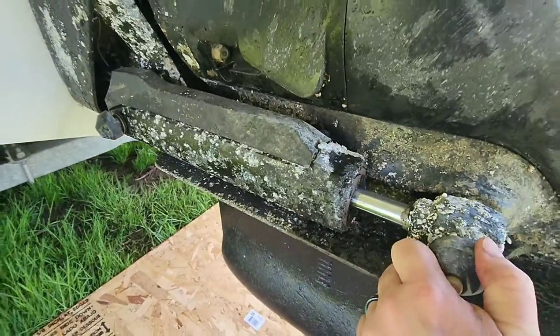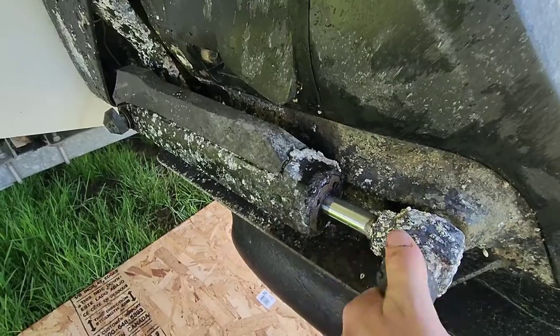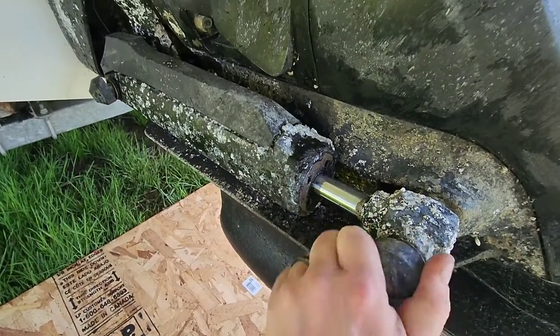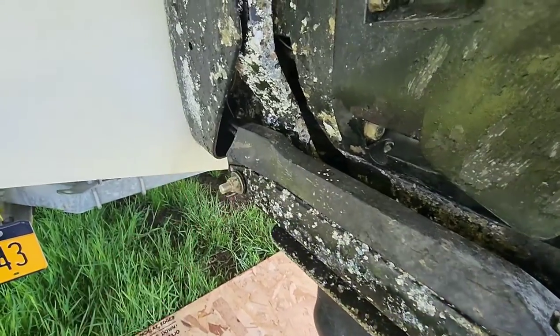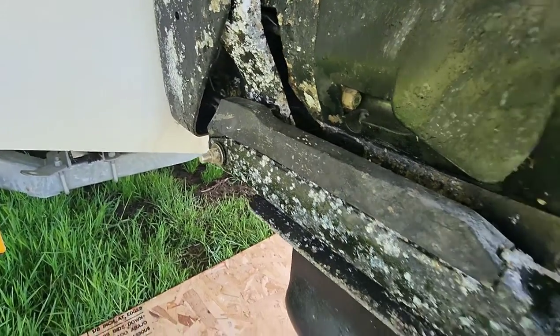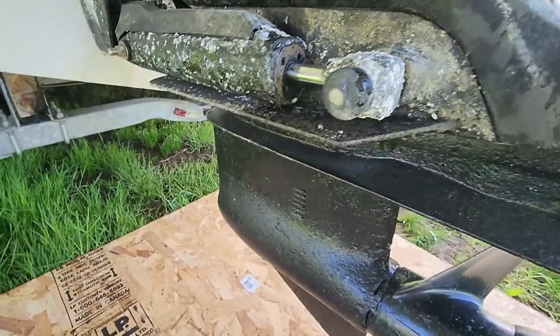First, we're going to start by taking off the trim tabs. Sometimes these just spin right off. If not, use that adjustable crescent wrench you got there. Once you get it off, you're going to find 5/8 nuts with washers. You're going to remove both the back one, front one on both sides.